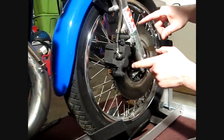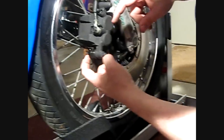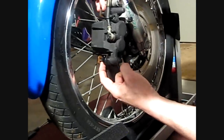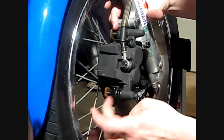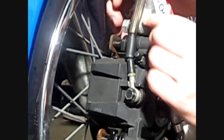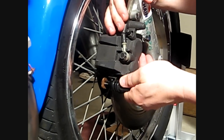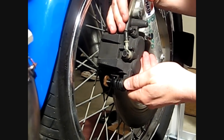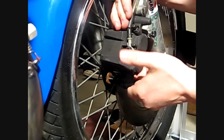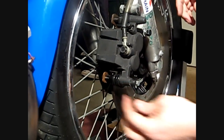The clearances between the rotor and the two supports for the brake shoes is very close. It's usually the lower one that'll make contact. So when tightening up these last two bolts, I always put a little bit of pressure moving the bottom up like that, and then tighten these down — and that'll usually get the clearance.